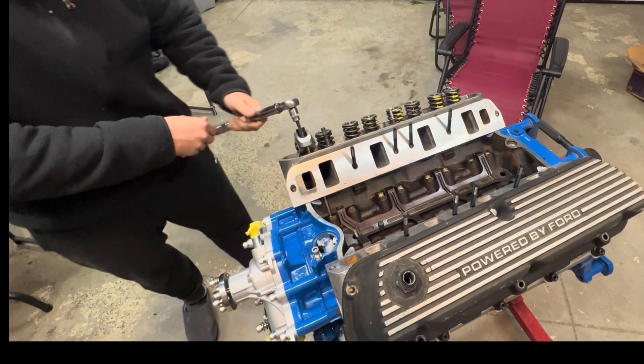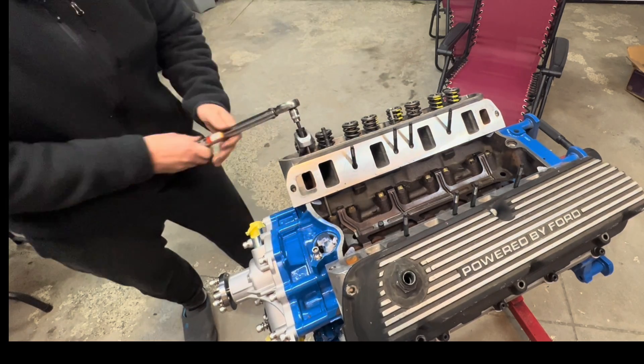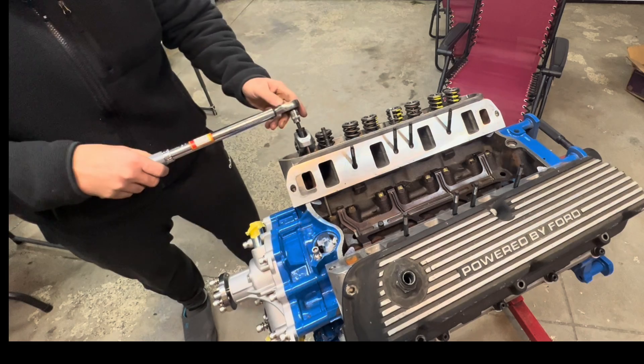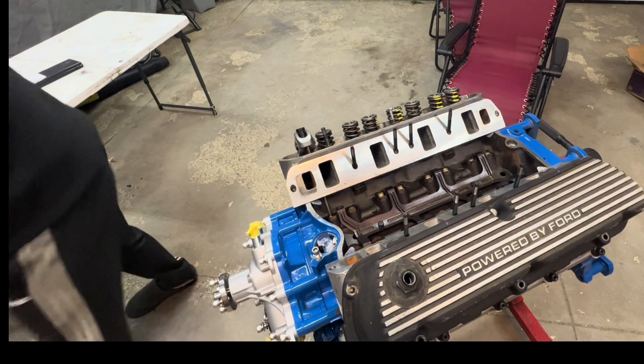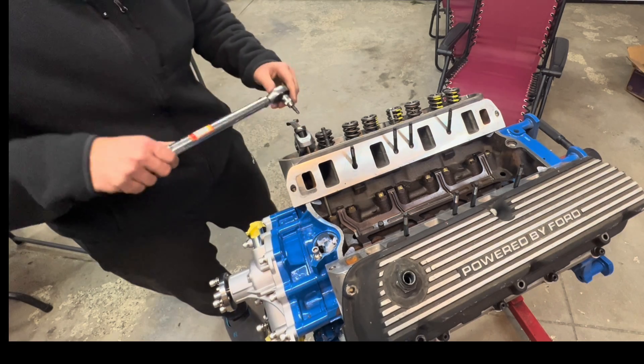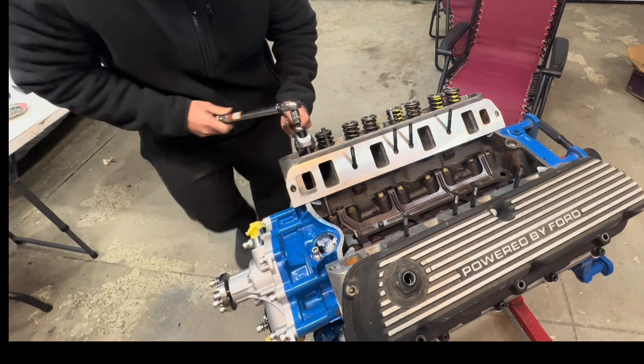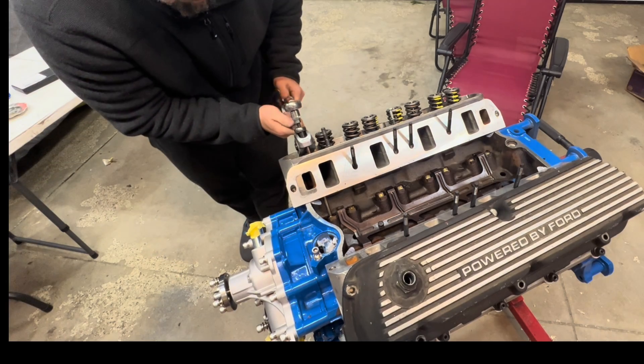These are really simple — it just says now you go half a turn. Half turn, done. Then we torque this down too. The center nut just calls for 20 foot pounds. I need to hold that in place, so take our 16 millimeter wrench and a 3/16 Allen head just to hold this in place while torquing.